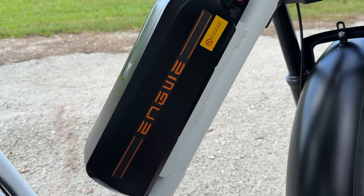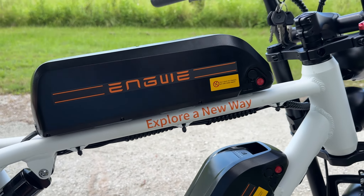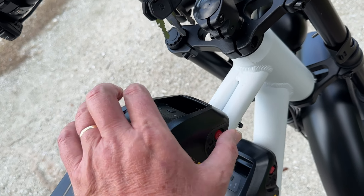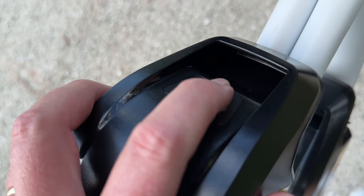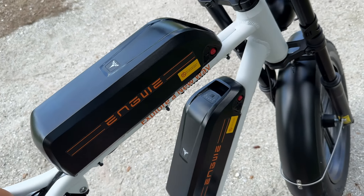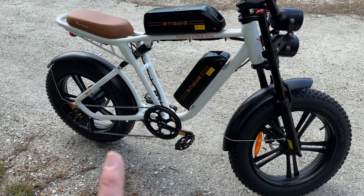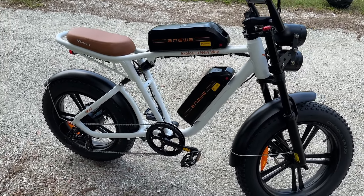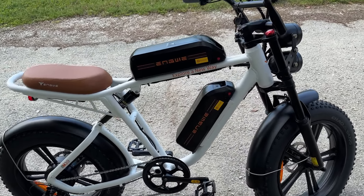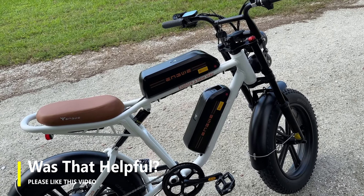Let's take a look at these batteries — we do have two of them, these are 13 amp-hour batteries each, so this bike has a whopping 26 amp-hours total. It does have the battery ports here to charge, and you have the on/off switch for both of them. You can click the button to see battery status, though I always pay attention to what the display shows. They only give you one charger, so be aware it could take six to eight hours to charge a battery. You may want to invest in another charger so you can charge both batteries at the same time, because they don't balance out when charging — you have to charge them separately.